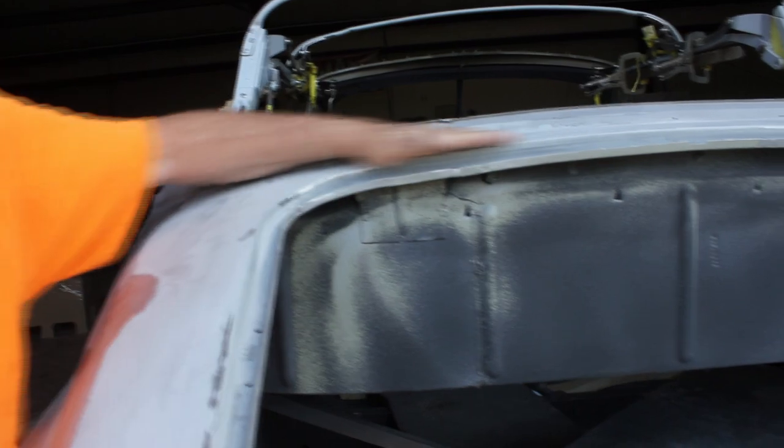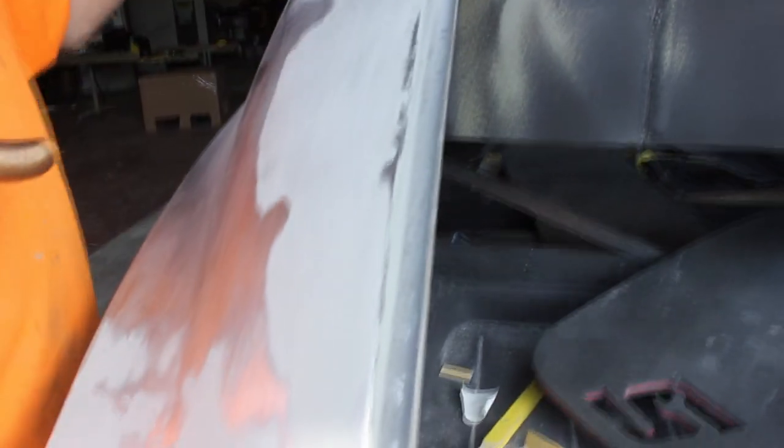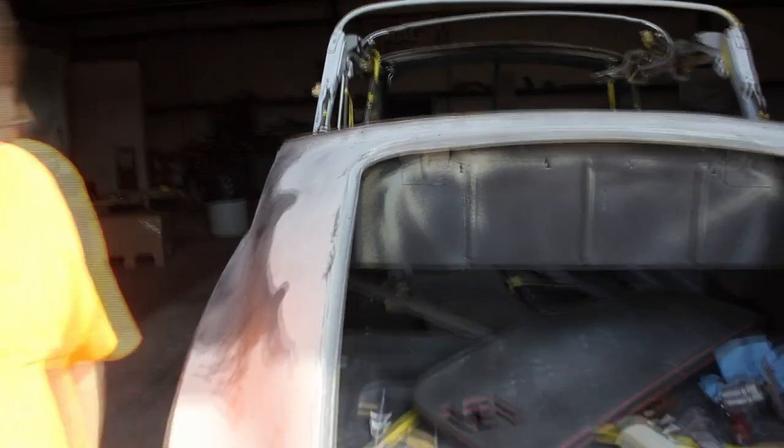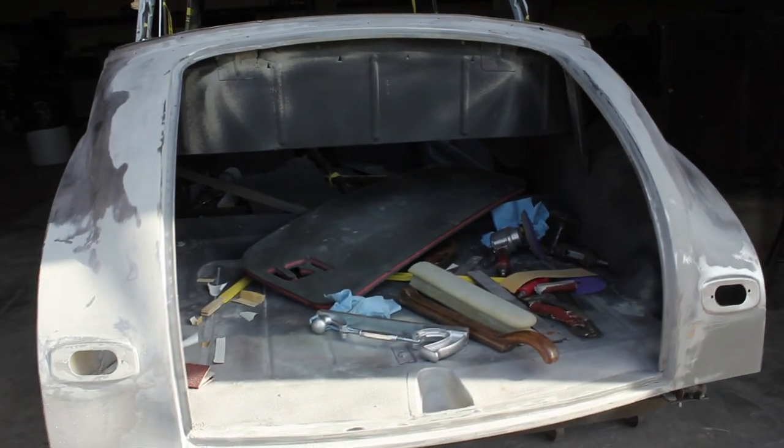No different than any of the lead I did on the sides or up the pillars and in the doors. You can see how smooth you get it with a file. I'm not far from being finished with this area. I have to do across the back and a little more up across the top. I've been going through these joints really well, and then I'm gonna get it all smoothed out and put a final coat on it. Then go all the way down to 80, get it in primer, and take it down to 120 and 180.